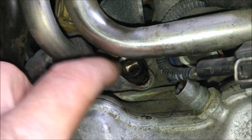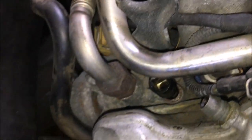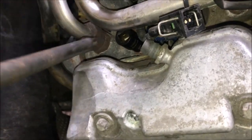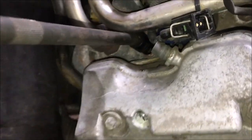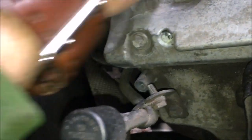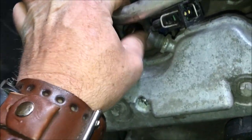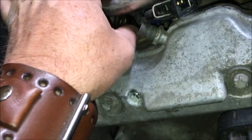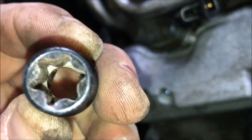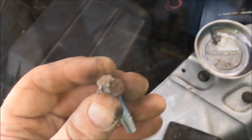It's a little hard to get past the fuel rail here, but put the socket on the bolt first, and then — because there's no room underneath the pipe — put the extension in there. I managed to get it free. I don't want to remove the whole fuel rail; you could do that but I'm not going to. The bolt is coming out — it's an E12.